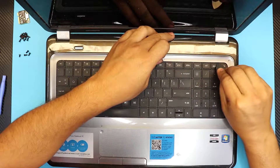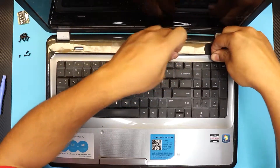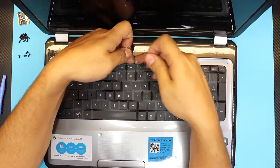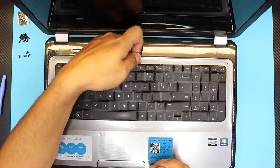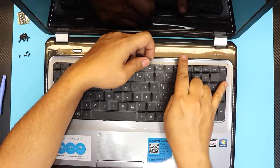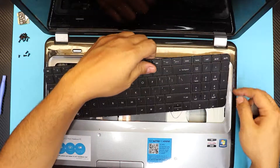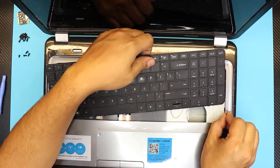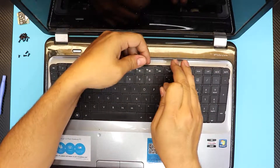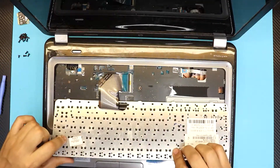The last clip is on the Page Up key. Once you remove that one, put your finger right on F8 underneath and pull up about two centimeters, giving it a slight arc to loosen up the side pins. If you can push the side pins, try to do it — otherwise just pull the middle so it bends slightly and the sides come out, then flip it open.